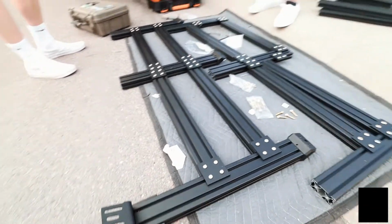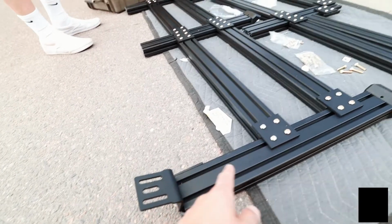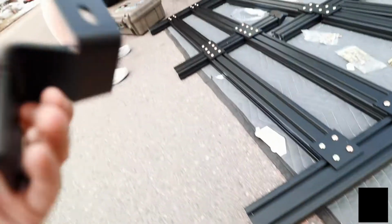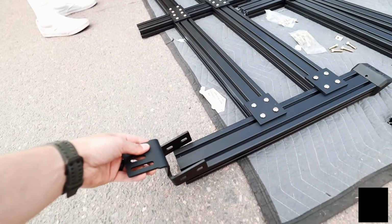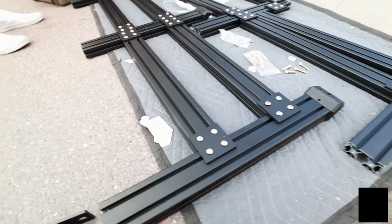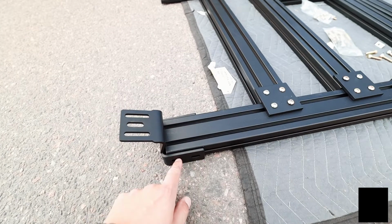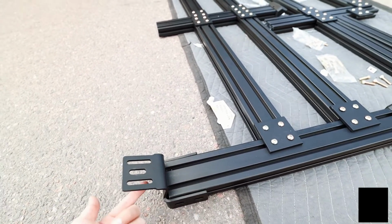Now we're going to attach the feet to this side. Same thing. You want the foot that comes inwards to match the side of these plates. That'll be where the rack actually mounts to the bedside. So it'll look like this, or if you have an L-shaped bracket for more bed space, that'll be the one you want to use. But these are going to mount with those same channel nuts and bolts that mounted these on the side. You'll have 2 on either side. Put those channel nuts in, line those holes up with those channel nuts and the bolts, put those on, and that'll be what mounts these to the bedside.